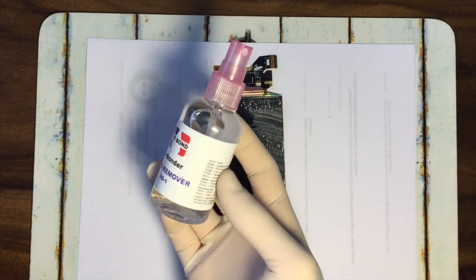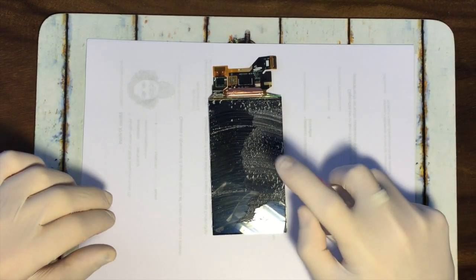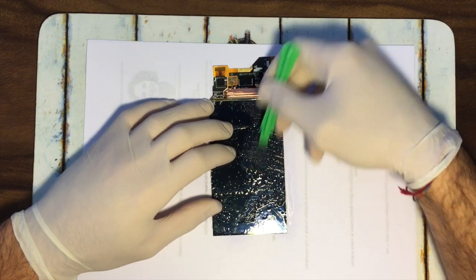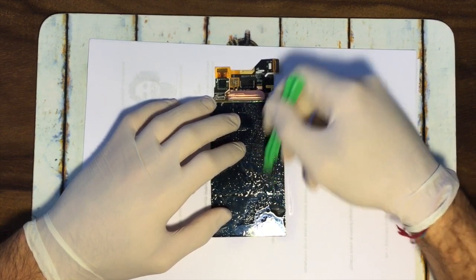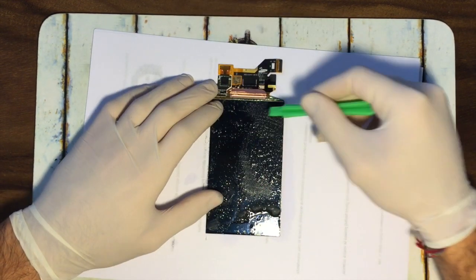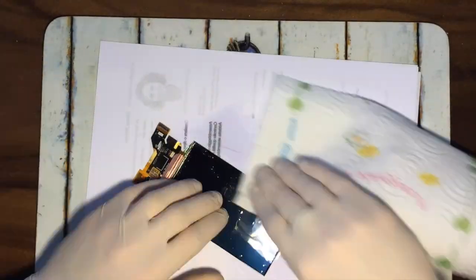After you've removed your glass from the LCD, you will have a lot of glue on the LCD, so you have to clean it. In order to clean it you can use a glue cleaner as you can see in the video, and you can use also a pick in order to take off the glue, and some tissue and stuff like this. This operation will take a lot of time, so again you don't have to be really quick — you have to take your time, otherwise you will damage the LCD and crack it.